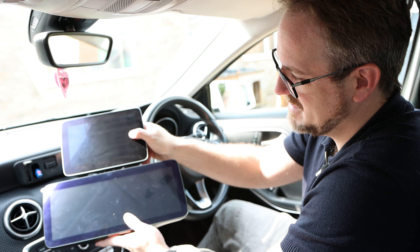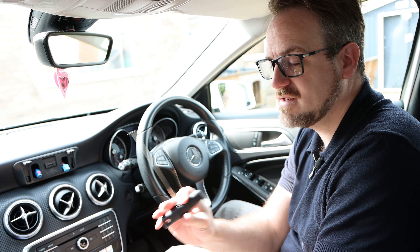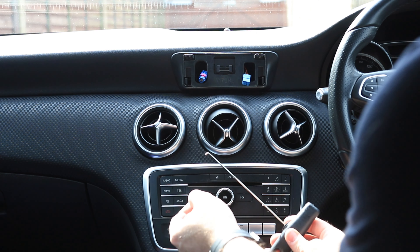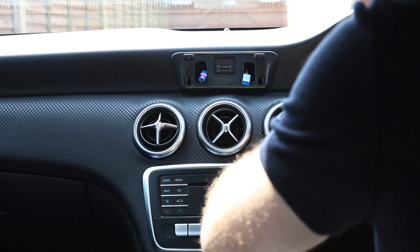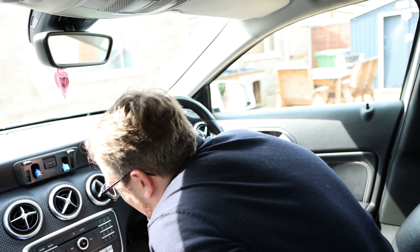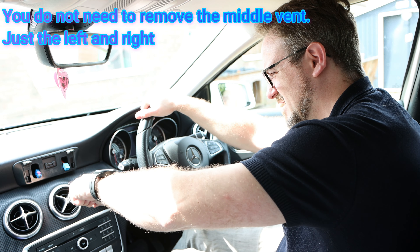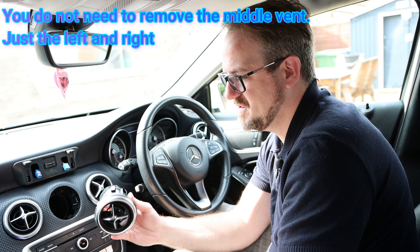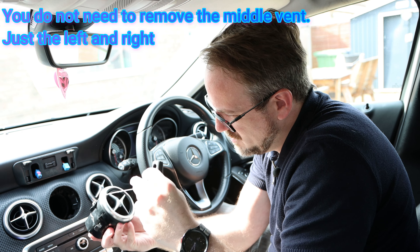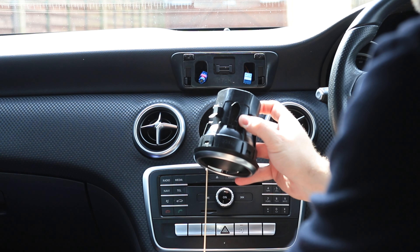As you can see, there is a slight difference in size there. Next we need to remove these vents and you need a special tool for this — something like this. It's basically just a piece of metal with a little hook on the end. I suppose you could do the same thing with a coat hanger. What we want to do is actually get it in on the bottom of these vents because there's a hole in there. We're putting this little tool in the hole here, coming out here, and hooking on this and then pulling it out.